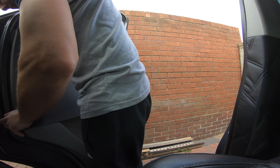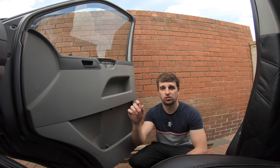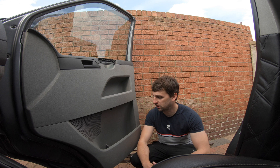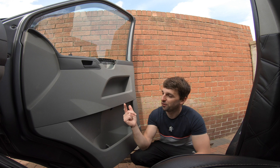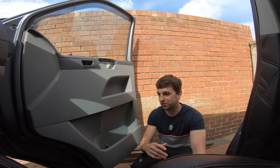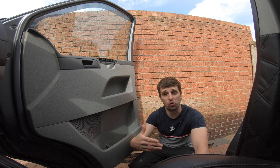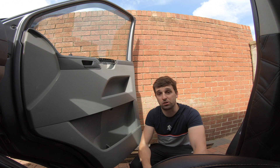I had a bit of a stupid moment. I put it all back together, turned the ignition on, and the lights didn't come on. Started the engine — still no lights. I thought something must be wrong with the power, so I took it all back apart. But the moment I took it off I realized: these are wired to the illumination circuit for the headlights. I needed the lights on. Obviously these are to illuminate at night — there's no point having them on during the day. Turned the lights on, worked fine. Just remember that — don't take it back off.